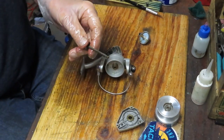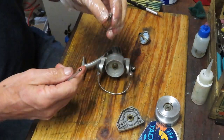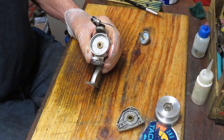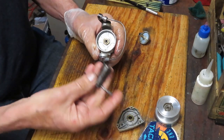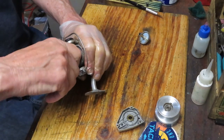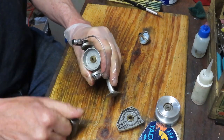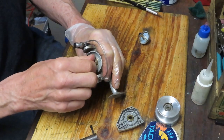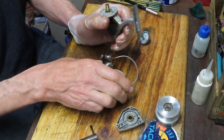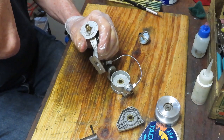Let's pull our axle shaft out. There's a little peg that holds the axle shaft down and helps with the oscillation. This should be a 12mm nut. I have a little tool that's a deep socket — you're going to need a deep socket because the ridge on the rotor is too deep. I turned it counterclockwise and it wasn't coming loose, so that means this is a reverse screw, and it is. It comes off by turning to the right-hand side.